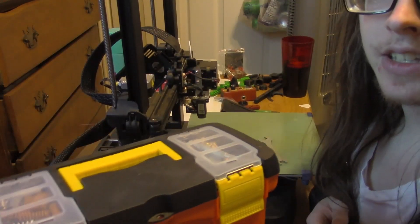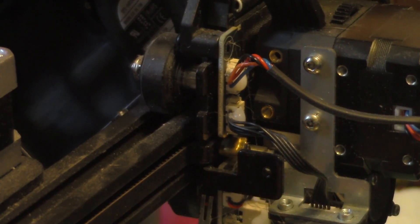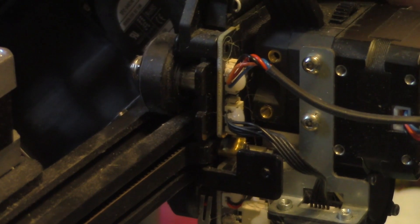I also talked about my 3D printing toolbox, which has come in handy for keeping 3D printing-specific parts organized — affiliate link in the description. What I find is that one of the V wheels seems to be pulled down, and I can pull the head back to proper orientation, but it returns due to belt tension. This is where I first mention possibly needing to replace the V wheels altogether. I didn't ask Creality initially because I thought they'd consider them a consumable item, but eventually I did ask and they agreed to provide them, since there was no reason they should have worn down so quickly — they had to have come from the factory defective.